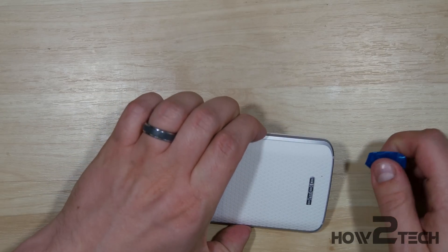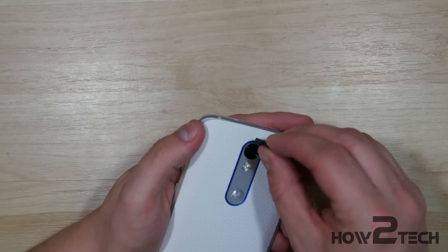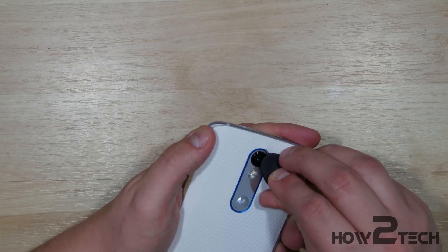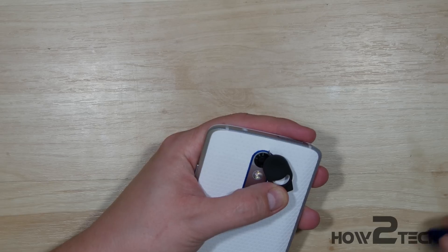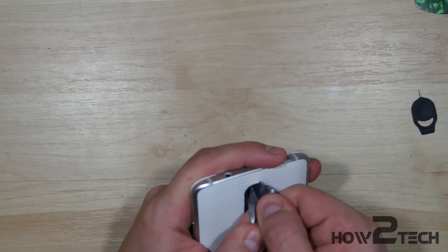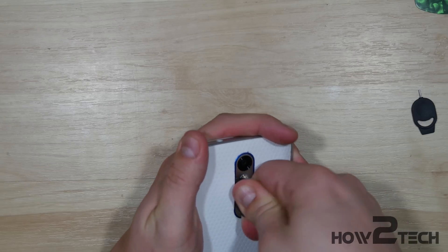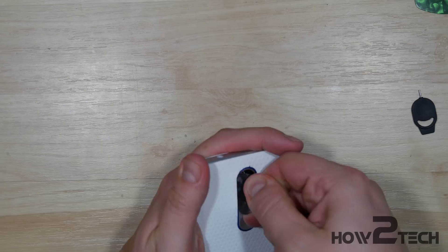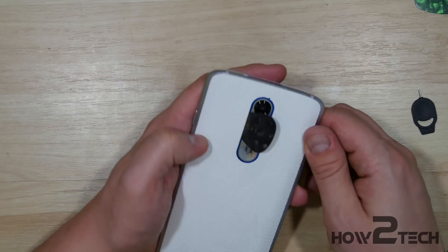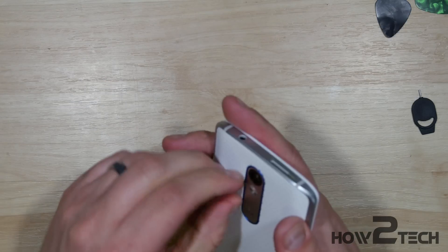Apparently we broke a guitar pick. We can try up here at the top as well. There's really not a whole lot of gapping around this phone. I found the easiest way to get this open is to take a SIM card slot tool and pull up here — you just want to put it right underneath the back, not too far in. We're just going to try to get this to lift just a little tiny bit. Then we can take a guitar pick and work our way around the side of this camera holder here. Just dip it in, remove the SIM card slot removal tool, and work our way around to loosen up some of the adhesive. We've got some tape coming out here, so we're just going to pull that out, and that should give us a good entry point back into the phone.